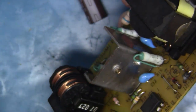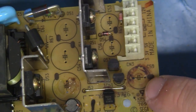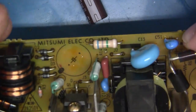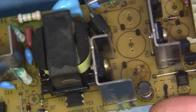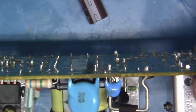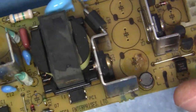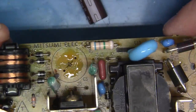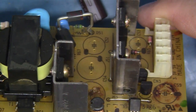Just like that, we have decapped our power supply. Now there are a few areas that are quite suspect — capacitors here, here, and here. We have electrolytic fluid that has seeped out; those capacitors are thoroughly well spent. Thank god this board is a single layer, meaning the bottom layer is the only section with solder resist, solder mask, and actual routing. If there was routing on the top we could be dealing with serious rot, but fortunately that's not the case. So let's take some IPA, cut through the electrolytic fluid, bathe the board, and get to recapping.